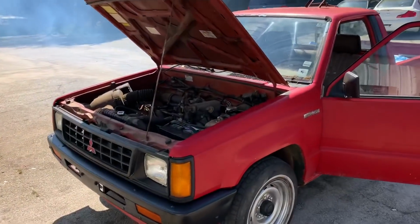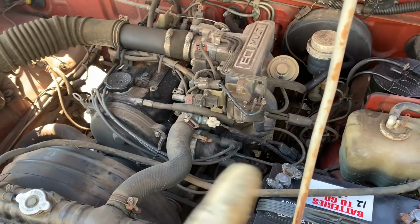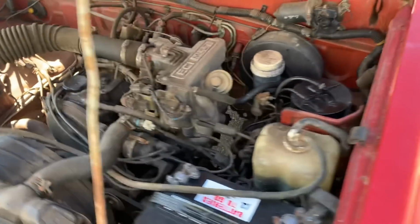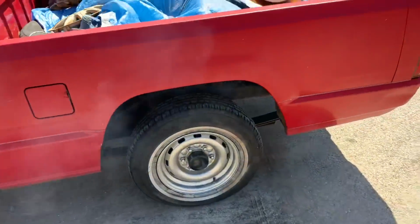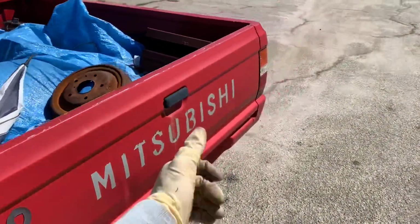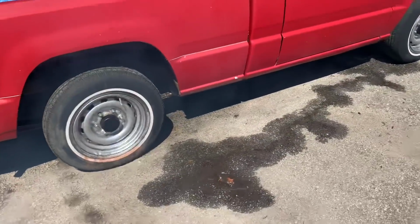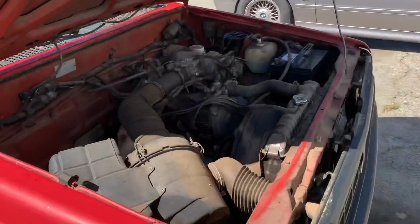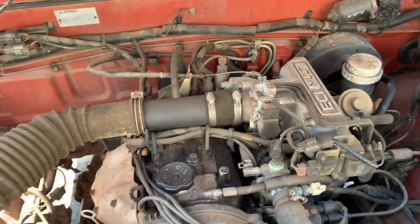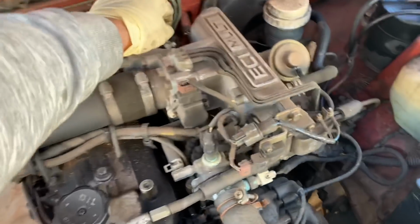So I'm gonna say right off the rip, it's still skipping, but the motor sounds like a million times better. The fuel filter's in, and I primed it 3 times and then hit the key. So while it does still have a miss in there, it really does sound a lot smoother, even with that miss.